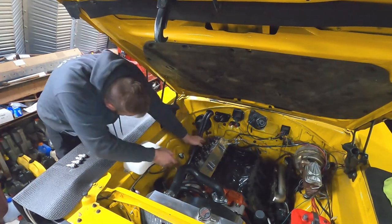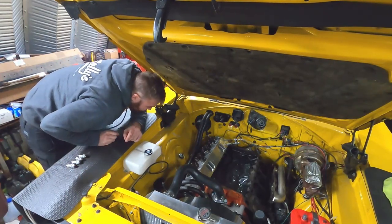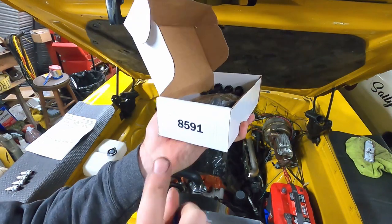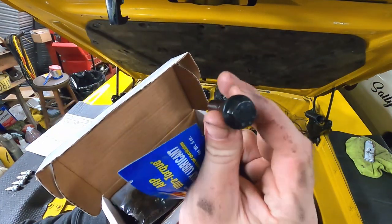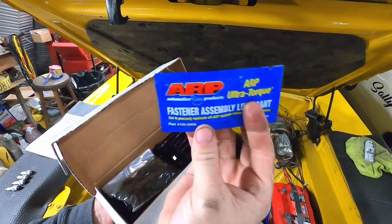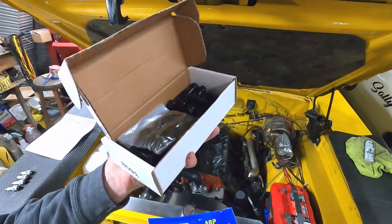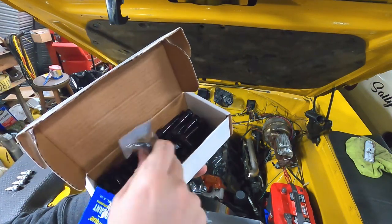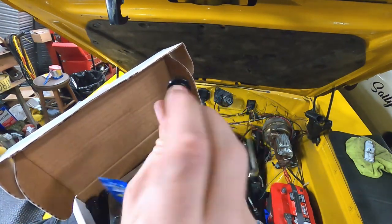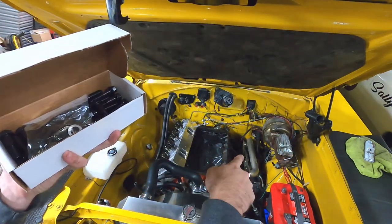Head dropped right into place. Now I need to get my bolts and start dropping them in. Instead of the factory bolts, we're going to be using this kit from ARP. It replaces the factory bolts with a really strong fastener that allows you to get better clamping force. They send it with their fastener assembly lubricant, which is good for getting the proper torque. We're going to put some of this on each bolt and drop them into place - put the washers on beforehand, obviously. The washers have a taper to them, so the taper side goes towards the bolt head when putting ARP hardware in. I'm going to get these all dropped in and then wait until I get the other head gasket to torque everything at once.